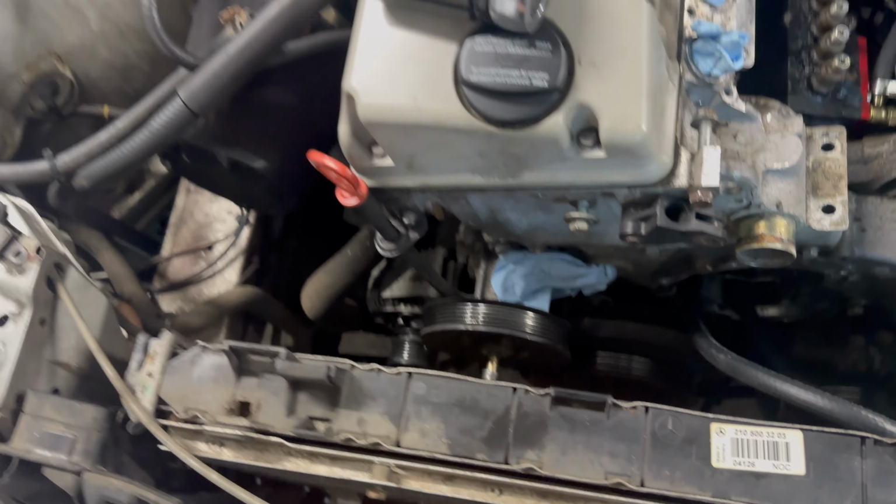All right, go ahead. The factory injection pump is out. Remember, your nut down here is reverse threaded, so you're gonna turn it clockwise. It's gonna be covered in oil. Don't worry about that. Are we stuck on something? Yeah, that line. All right, injection pump is out. Don't forget to undo your cable cord here, and then make sure you do what I did and get oil all over the floor.